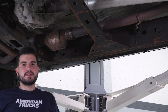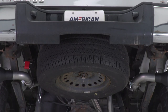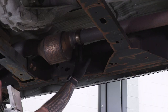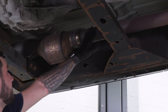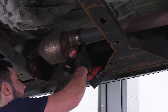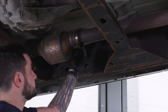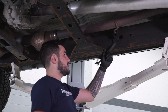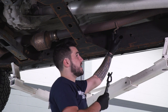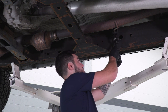Before we get started, it's worth noting that this whole uninstall process of the factory cat-back we're doing on our 4.8-liter Silverado applies also to the 5.3 — it's gonna be the exact same case. It's gonna start with this 13-millimeter clamp holding our factory cat-back to the cat pipe right here. Grab your 13 socket and loosen that guy up. We don't really need the sockets anymore — we're just gonna switch over to a hanger removal tool, which I definitely recommend. A pry bar works as well. We have a bunch of hangers we need to pop out of some isolators, so grab your hanger tool and basically pry these guys out.